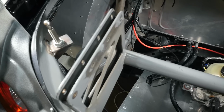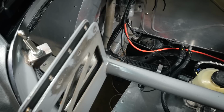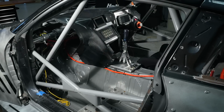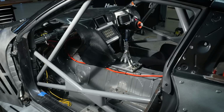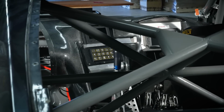The rear harness. This section controls the fuel, oil, and cooling pumps, the power steering pump activation, as well as the tail lights, brake lights, and the reverse camera. And lastly, the in-cabin wiring. In this harness, we have the R5, the 15-button keypad, the iC-7 dash, the shift knob, as well as the battery. This section is where all four harnesses come together through the firewall bulkheads.